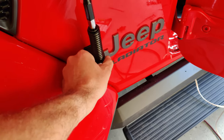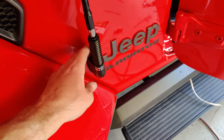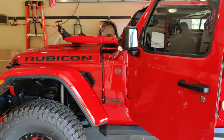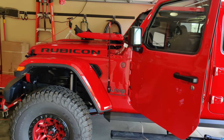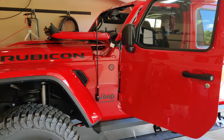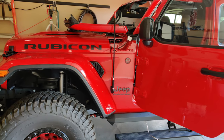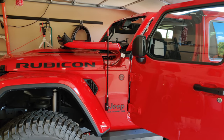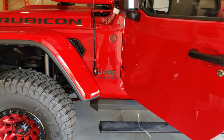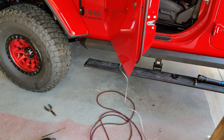It's got two good bolts behind it — one is behind an insulator so it's not touching the frame, and the other is between the bolt and the mount plate for a ground. I think it looks good and it's the right height — I didn't want a four or five foot antenna sticking above the roof line so I'd never be able to get in garages. If I ever want to increase to a three foot antenna I can just unscrew the current one, screw a new one on, retune it, and problem solved. For now I'm really pleased — the install looks almost OEM, right down there by the Jeep logo, super rigid.